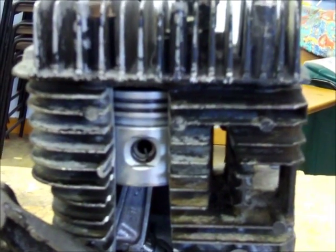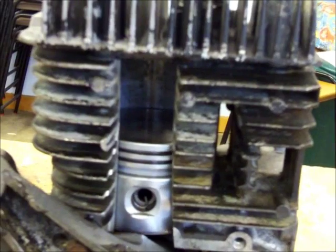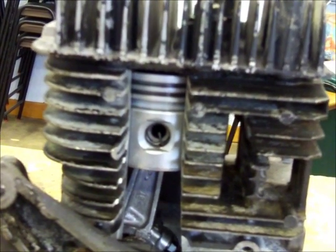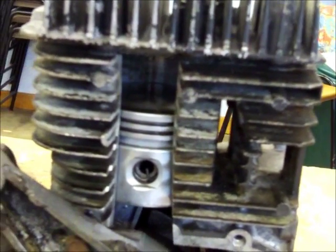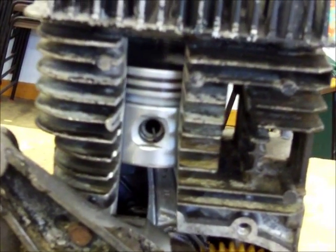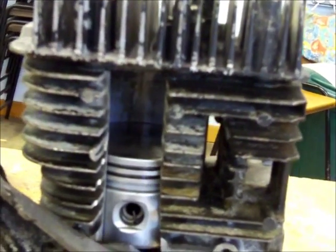The 4-stroke engine provides power on only one of the 4 strokes. This is a stroke as the piston comes down, it draws in the fuel air mixture. On its way up, it compresses that mixture. At top dead centre, the spark plug ignites the fuel air mixture, and the expanding gases force the piston down. This is the power stroke. The piston then travels up, and the exhaust gases leave the cylinder, and the whole process starts again. Induction, compression, power, exhaust.